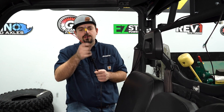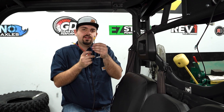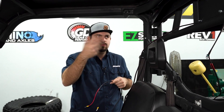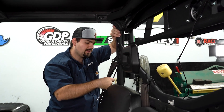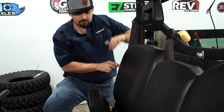You're going to grab the wire coming off of the control box — it's going to have a black and a red. The black is going to go to a ground on the battery, and the red is going to go to an all-time hot on the battery. One thing you could do is route it along this cage here, drop it down, route it behind the seat belt, then follow the body panel all the way down to the floorboard.